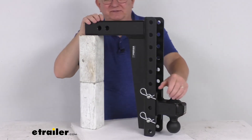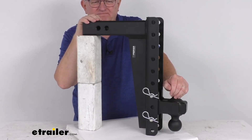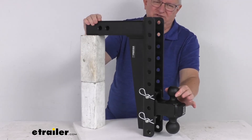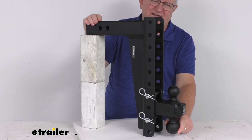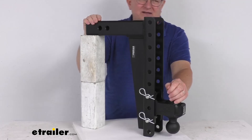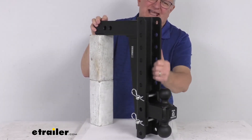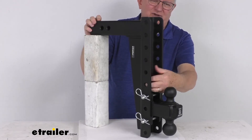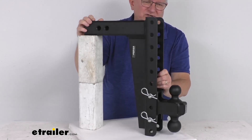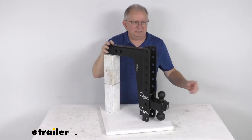This fits a two and a half inch by two and a half inch trailer hitch receiver. The large drop or rise version is ideal for vehicles with 31 to 33 inches of clearance from the ground to the bottom of the receiver. Gross towing weight capacity is 12,000 pounds with the two inch ball, or 22,000 pounds with the two and five-sixteenths inch ball. Tongue weight capacity is 3,000 pounds. There are also various channel mount attachments available — including a pintle hitch, shackle hitch, and hitch step — listed as related products on the product page.